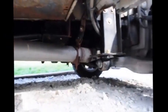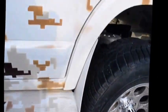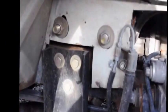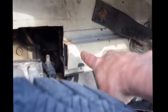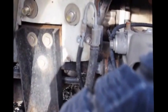That's the exhaust. That's the transmission crossmember and the frame rear strut Crown Victoria support, which bolts up into the frame. It bolts up into my original augmented frame. You can see those two big bolts there — it's got quarter-inch steel on the other side running perpendicular up to the midpoint, and it does the same thing in the front. So it's not only welded into the frame, it's bolted in as well. That helped me get the alignment geometry set up with the right angle — I believe it's a couple of degrees towards the rear — to allow the wheels to be at the right caster angle so that it rides properly.